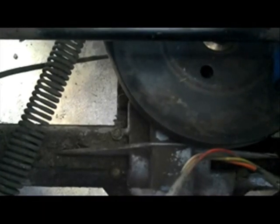On the MTD VariDrive models, the transaxle only provides gear reduction and shifts between forward and reverse — it doesn't actually select any speeds. The variable pulley, which is right here, is what actually controls your speed. There are two belts on these models: one runs to the front of the engine and one goes to the transaxle at the back. The variable pulley connects the two.